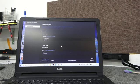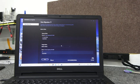Depending on the speed of your processor and how much RAM you've got — mainly the speed of your processor — is really going to dictate how fast the cloning process goes. Normally I would do this outside the computer in my cloning station because I can knock them out in about 6–8 minutes. It won't do it quite that quick on this computer. She doesn't have a lot of data on here but it could still take some time. I'll fast forward this on the video so you don't have to sit and watch the whole process.